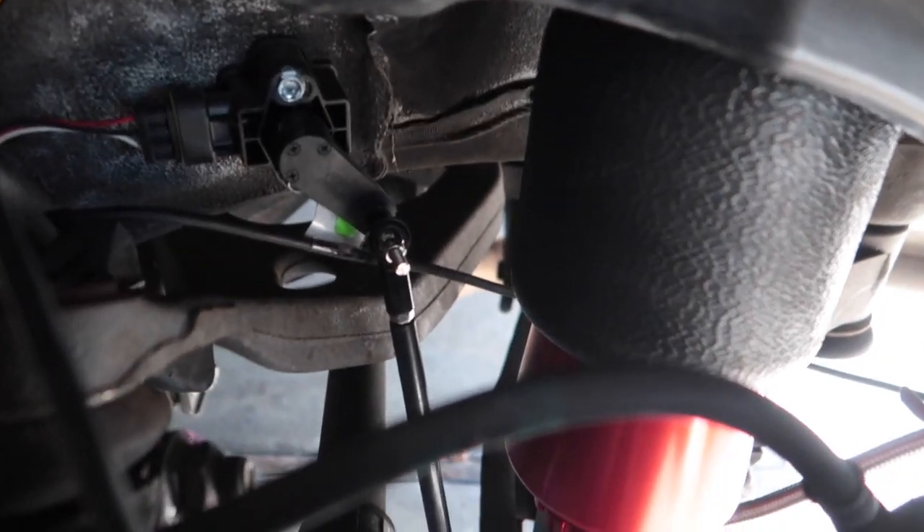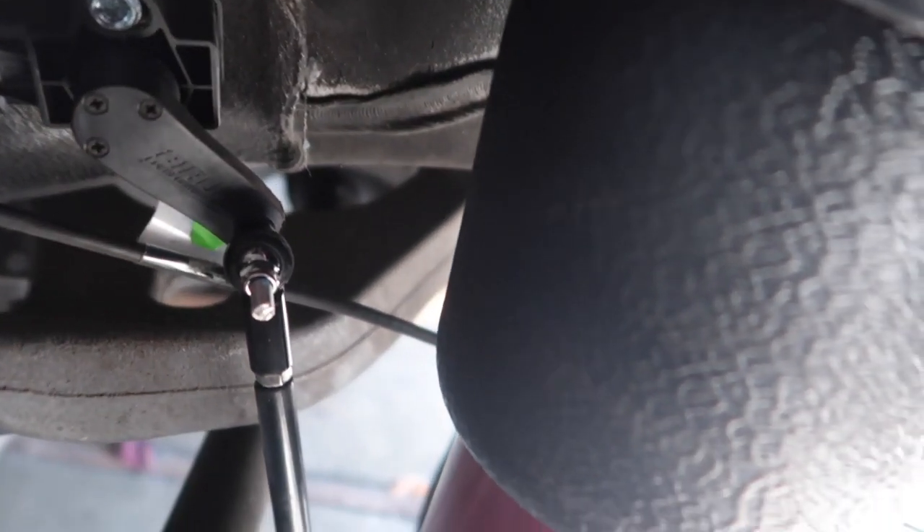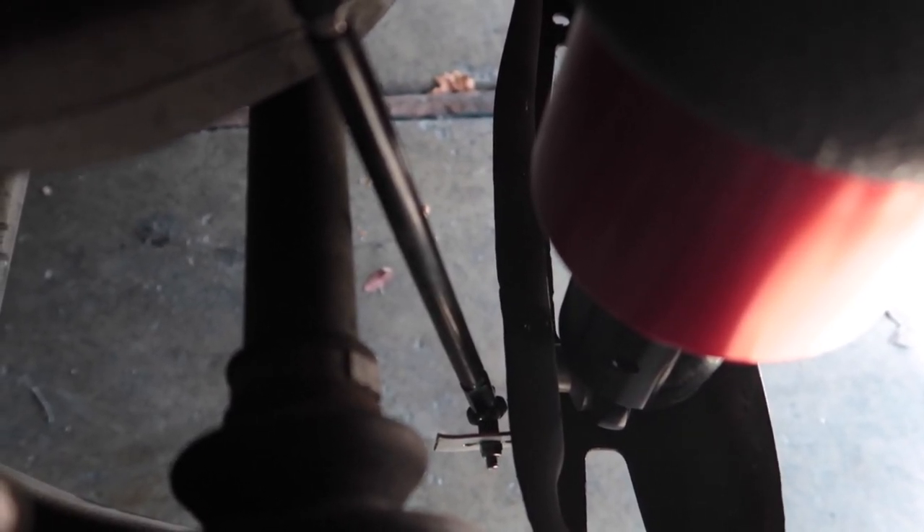The rears are installed. I mounted the height sensor right about here and connected a bracket onto the lower mount of the strut. The reason I chose to put a bracket there is because it almost mimics the travel that's going on with the strut — so if the strut is traveling say three to four inches, I'm going to get three to four inches of travel on the height sensor. That was my logic and thinking behind it.